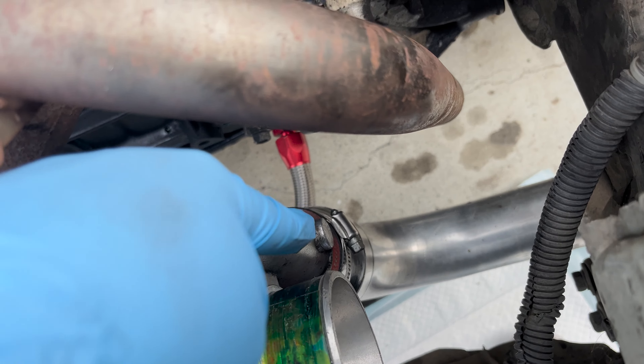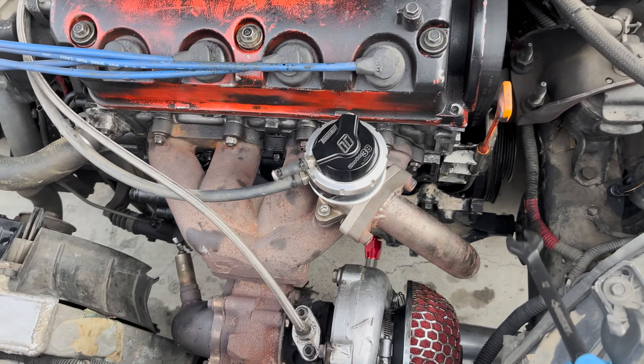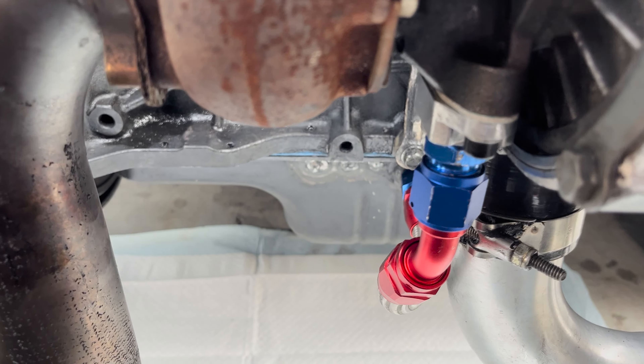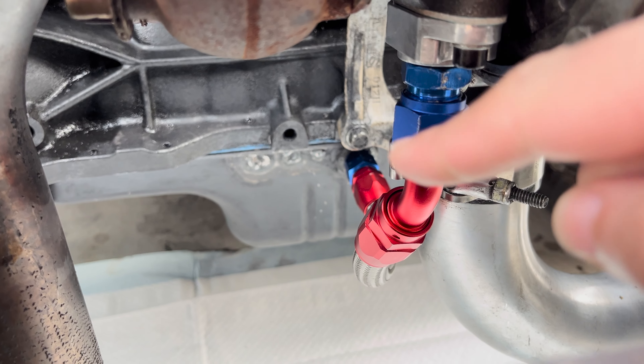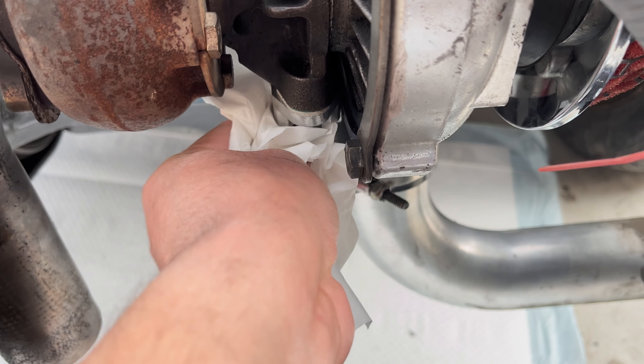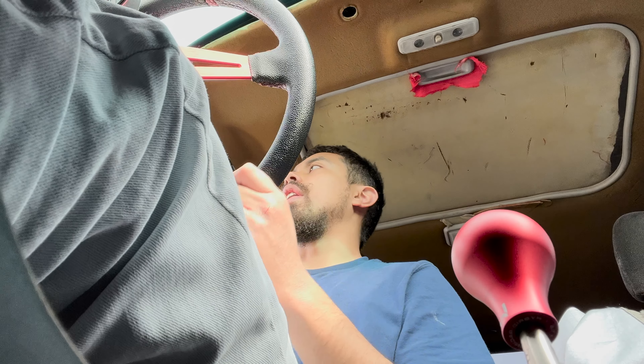It's looking pretty dry. Coolant's good, oil is good, wastegate is good, exhaust manifold and gasket are all good. Moment of truth — the line is clean so we should notice any leaks. So far so good. I'm grabbing a little napkin and passing it over and under the hose to check for leaks — it's dry. Let's go! Little stuff like that makes me happy. Let's put it under load and see — it should hold up fine.